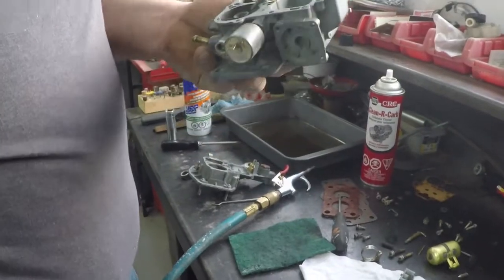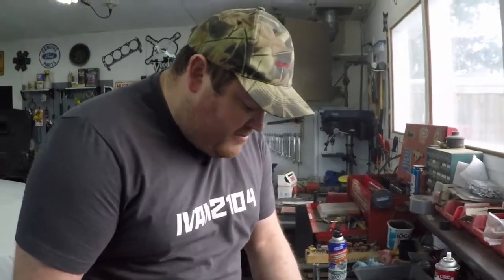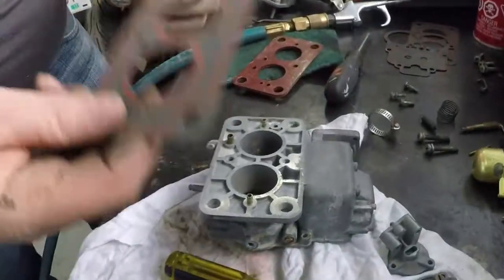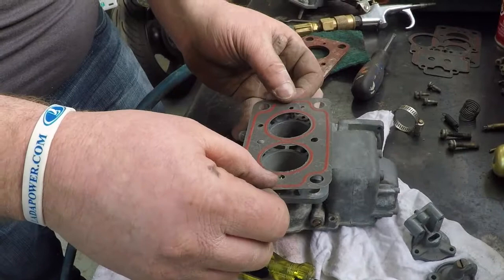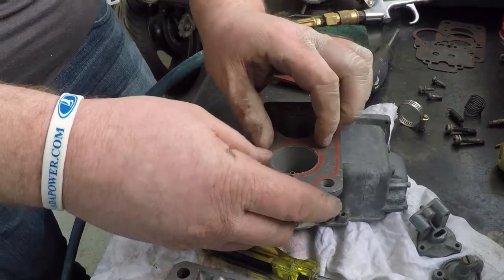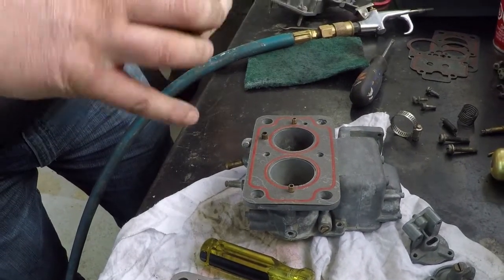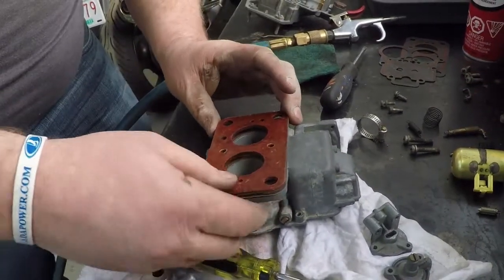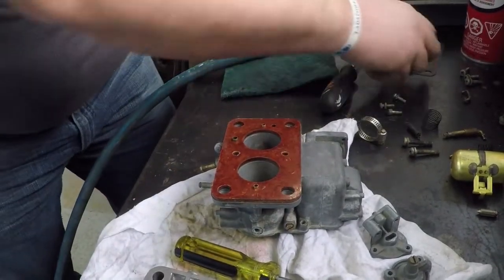And now we're ready to put this piece down onto the base plate. I have the main body inverted upside down so that we can start putting gaskets together to reassemble the base plate onto it. These go in only one spot in a very specific way. They have to go down over these little brass nipples so that everything lines up. It all only goes one way. You can't put them on backwards or mess it up. If you do, it's because you weren't paying attention.